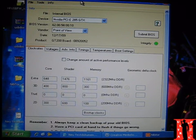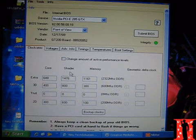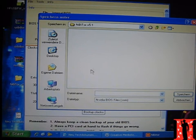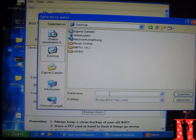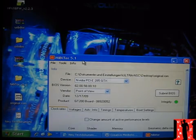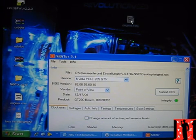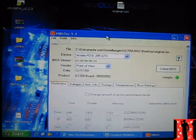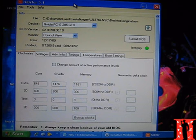You do nothing here right now. What we do first is save the original BIOS — this is the original BIOS untouched. Don't touch anything here, don't rename it, don't change anything. Just go to Save BIOS, save it to the desktop, and name it something like 'original'. This is now our original file. We don't touch it now.